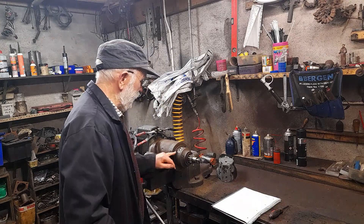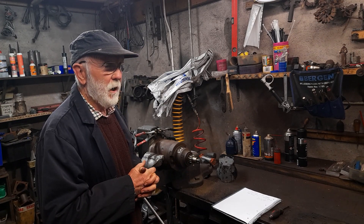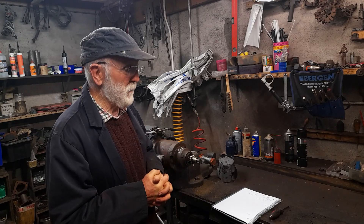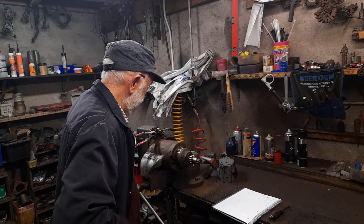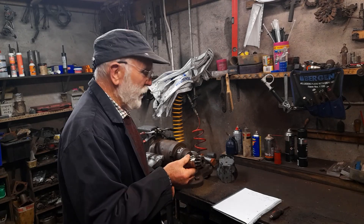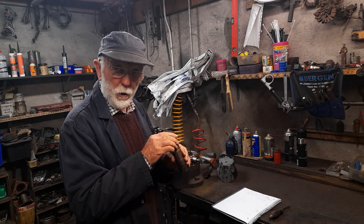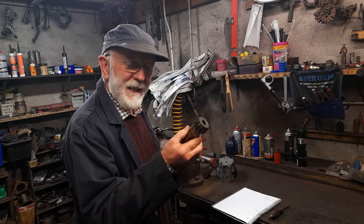You'll notice that this one's 12 volts. I have a few of these 12-volt starters, and 12-volt starters and 12-volt alternators are getting difficult to find — most lorries and trucks were generally 24 volts, so 24-volt is much easier to get. There may be a few more of the Sims type in 12 volts. Regarding the pinion: this is a 12-tooth pinion, generally associated with the five-inch SL5 starter. The six-inch starter uses a 13-tooth pinion — the flywheel ring gear pitch is the same but they use different tooth counts on the pinions.